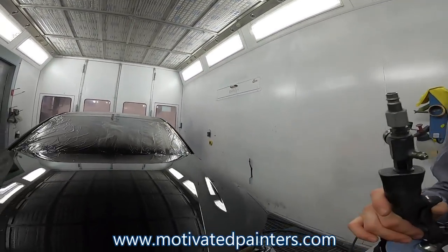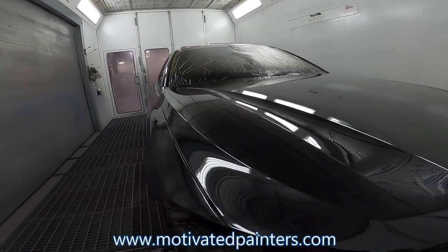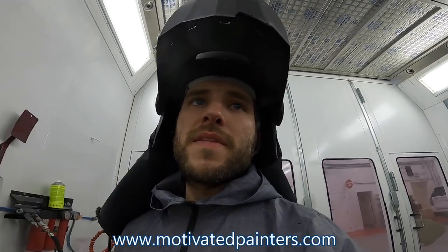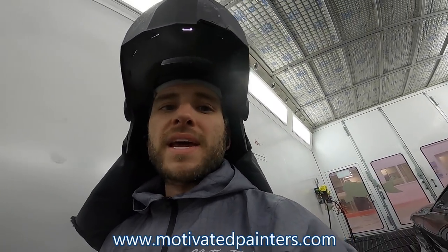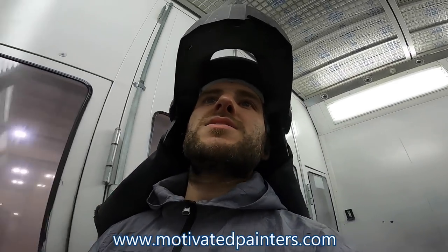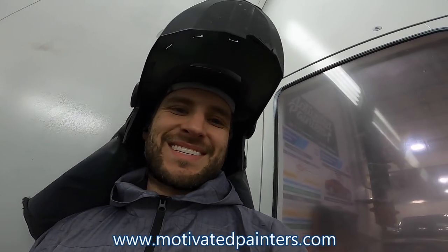Yeah, look at it. Looks beautiful. So I will let this flash for 10 minutes. And then what I've been doing is, after it flashes for 10 minutes, I bake it for 30 minutes at 160. 30 minutes at 160 degrees.